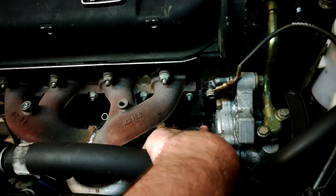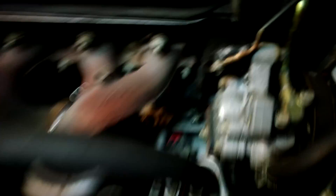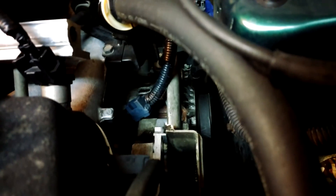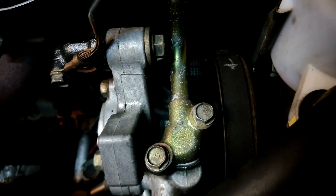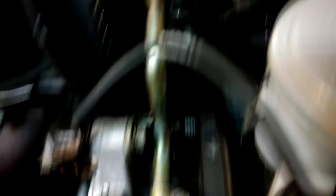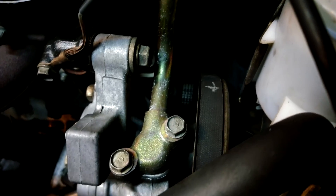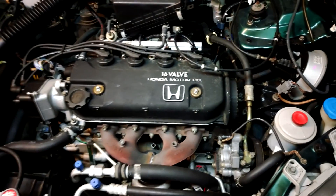The power steering pump lined up okay — the two bottom bolts lined up well, but no top bolt because I think the head is a little taller. I had to use the B7 alternator belt on the Y7 OBD2 alternator, so that's how that worked out. Power steering pump was off the Y7 with the Y7 belt. The AC setup down there is a little squeaky. I think there may be a difference in block length or width, so to sit tight — because it's tensioned all the way right now — I may need a D15B7 belt.